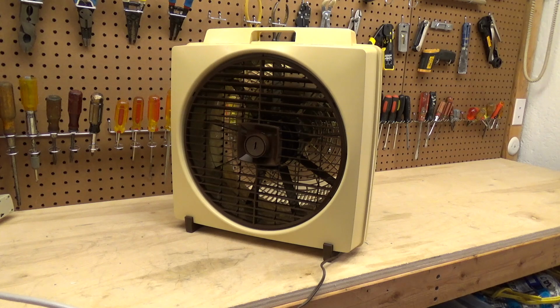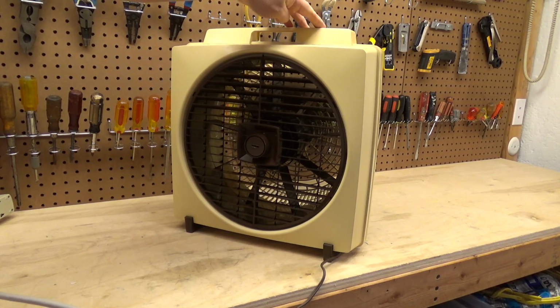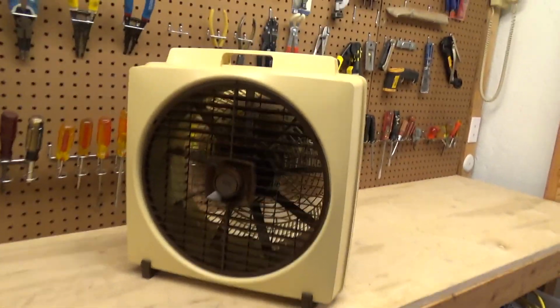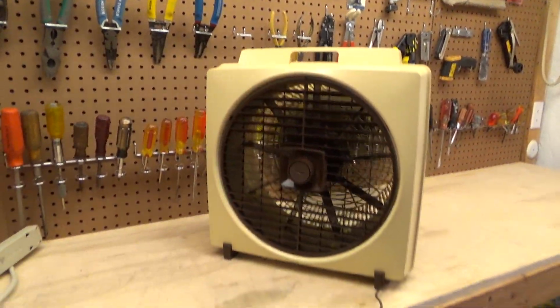And across the room, tremendous amount of air. This is really, it's super powerful. Probably one of the most powerful fans of this size. It's just really incredible. That's about 80% power, 85%, 1.97 amps, 119 watts with a power factor of 0.5. And this is just absolutely blasting. And it's still so quiet.